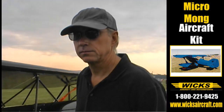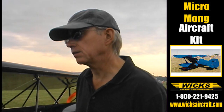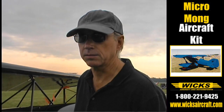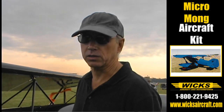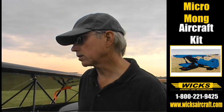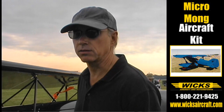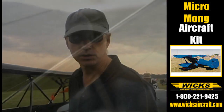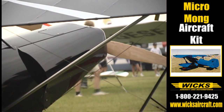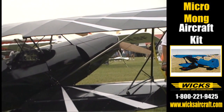Is there any changes that you've done to the airplane? There are a few changes from what Ed originally designed. With this plane, the wings are about a foot wider. The fuselage is about 9 inches longer because I'm taller than Ed. It has a different shape to the rudder, the control surfaces have a little bit more travel, and it has a different engine — a 2SI engine instead of a Rotax. And a different style nose bowl, plus minor things like streamline tubing.